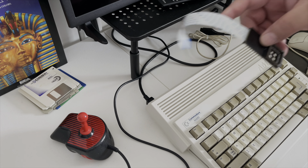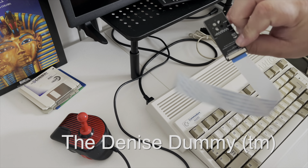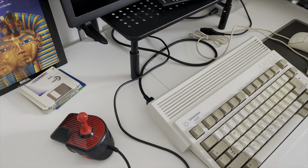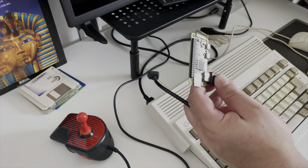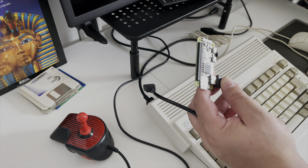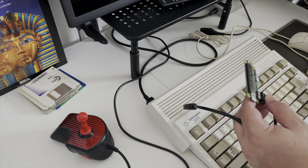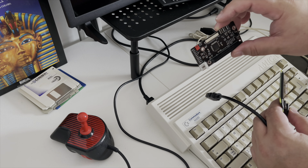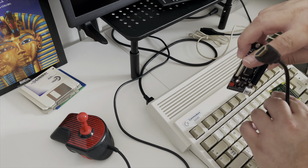What you will need is something like this — this crazy-looking thing which clips onto the video chip. It has this wacky-looking ribbon cable — isn't this fun? And then you need one of these: a Raspberry Pi Zero W. Just the Zero W is fine for RGB-to-HDMI; you don't need a W2, a W1 works great. That sandwiches onto the actual RGB-to-HDMI circuitry. These guys mush together, that cable goes in here, and then you get your HDMI output.